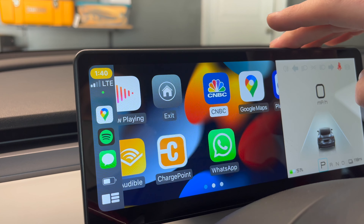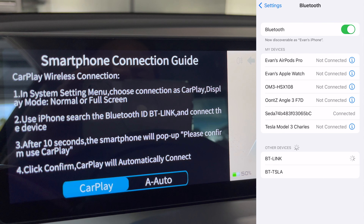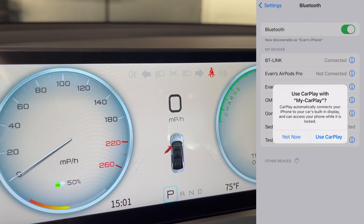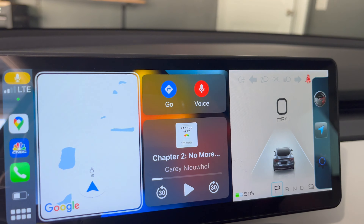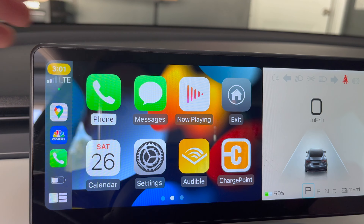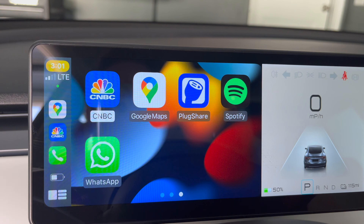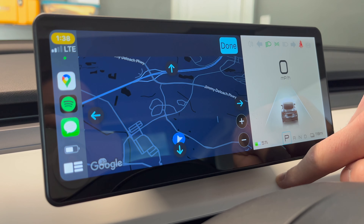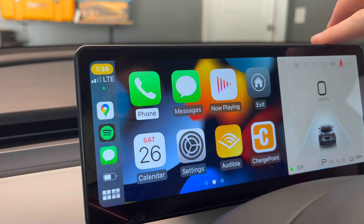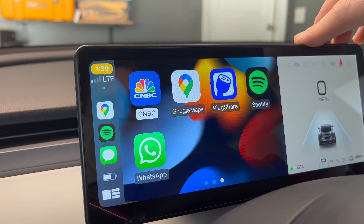To enable CarPlay for iPhone or Android Auto for Android phones, just go into your Bluetooth settings menu in your phone and select BT Link Device. You should see an icon that says pair, then allow you to sync your contacts, and then select the option to use CarPlay. After this connection with your phone, go back to the display and CarPlay should now work by choosing the GPS arrow icon back in the menu option. The CarPlay menu is not very fast when scrolling through apps — I've noticed at times there can be a one or two second delay. I haven't yet explored all the compatible apps with CarPlay but may post another video showing more functionality.